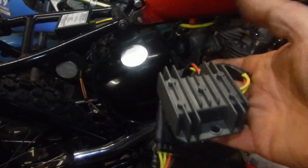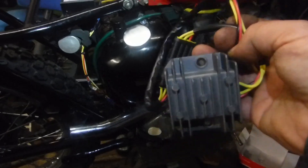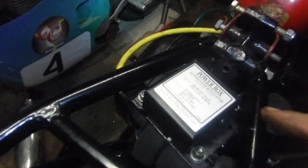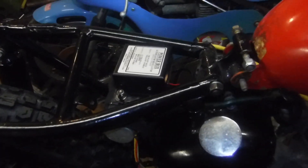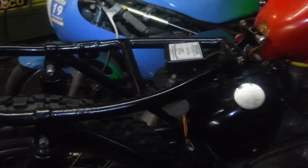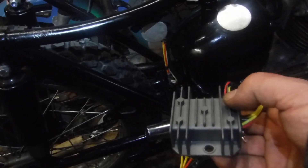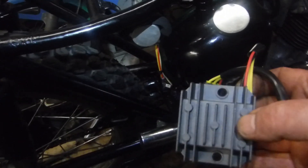So in my infinite wisdom I bought another one brand new, which arrived today — and guess what, the same thing happened. So I'd also ordered this other unit. This is not an electronic ignition; this is another regulator rectifier, and this one has a built-in capacitor. I've had quite a lot of success with them in the past, so I decided I'd just connect that one up and see what it did. The engine started with no help from the battery charger. Strange though it may seem, when running off the battery charger, the alternator through the first unit would light the bulb — but try as I might, I couldn't get a cough out of it on the kickstart. Nothing happening.